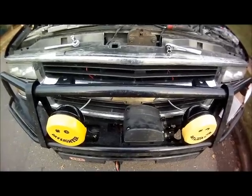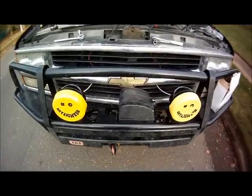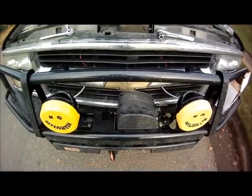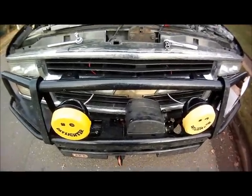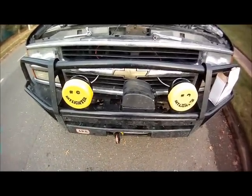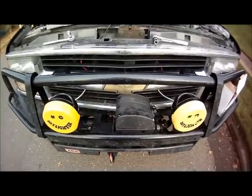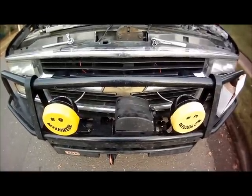After speaking to one of the engineers at Super Winch, it turned out that the solenoid pack had indeed gone bad. So after having that discussion with them on a Tuesday, they shipped out a new one on Wednesday. They 3-day aired it to me, so it's great support from those guys. Always enjoyed having their stuff on this truck.